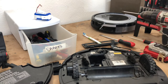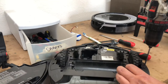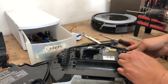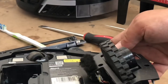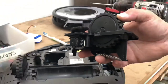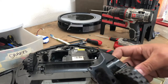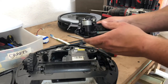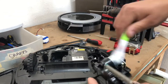These are external removable wheels, meaning you can remove them without taking the body apart. Some 700 and 750 series robots you have to take the body and everything off — it's a little bit more of a pain, but it can be done. Now that we have those screws out, we're going to wiggle the wheel. The wheel's going to come up and there's going to be a little cable with a little clip — just pull the clip and the wheel comes off. Inspect it; it sounds good and has free play. When it's in and there's power to it, it won't free spin — the wheels will still have a little bit of resistance. Let's get all our screws out, brush it down, and clean it off with the air compressor later.